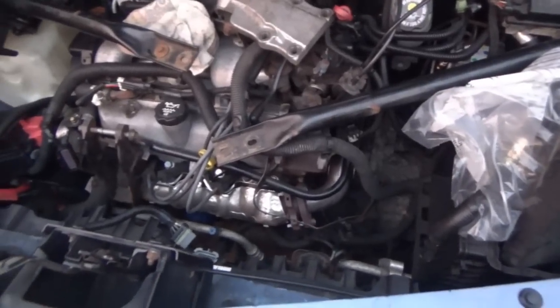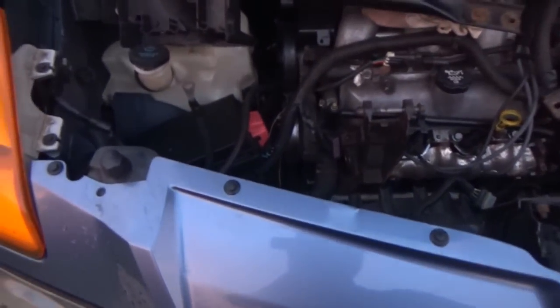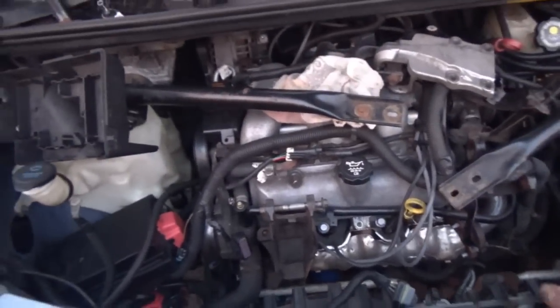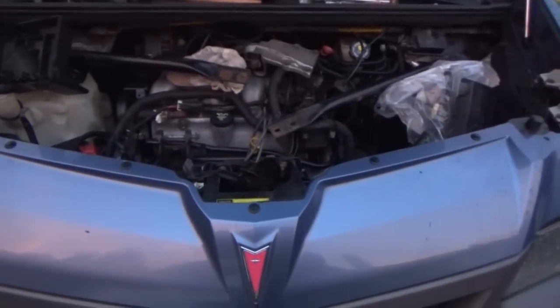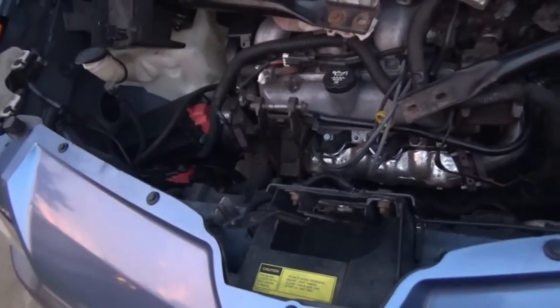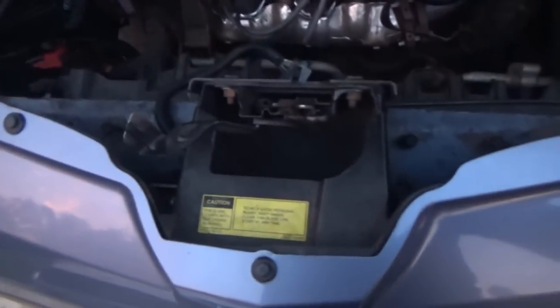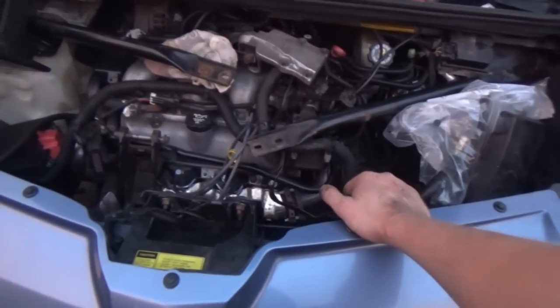I guess what I'm going to do now is try to hook these transmission lines in while I still have light. Hook the lower hose up. I think I can put the upper hose on now too. Maybe put the computer back - it doesn't have to be sitting out anymore. Then kind of clean up a little bit while I have light. Tomorrow when we have daylight, we'll fill it up with coolant. I'll finish hooking up everything else, all the electronics and stuff. We'll get it running again to see, hopefully, that this radiator is in good shape. May even test the power steering. In the previous video we changed the transmission filter also. I don't have transmission fluid yet and I'm not even 100% sure if that line's going to stay in place yet. We're getting close - I'll see you guys in the next portion.